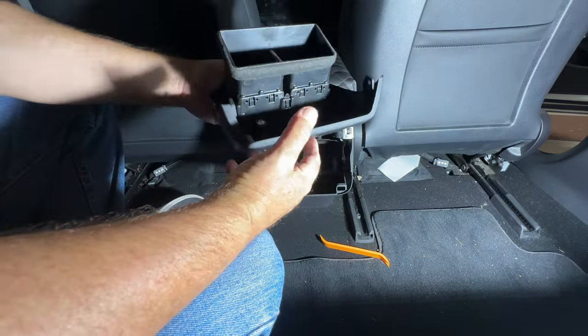All right, so if we look at the wiring, I've got that panel back on. So this is the one for the seat control. Here's the original one that we took off. And then here's the new one. So we have the two connectors. This green one's going to go to that green one. And then the other one is going to go to the display. Let me double check that. All right, so I've connected the green ones together, right? This is the one I pulled out from the OEM one. This is the connector here. And as you can see, there's two connectors coming out of this one. One's going to be for the original OEM one up top. This small one is going to be for this one. And I believe I'm going to double check it. No, actually, it's this one because you can see the multiple colors. And it only goes in one way.